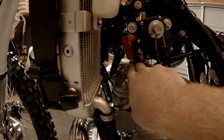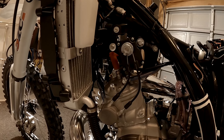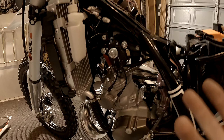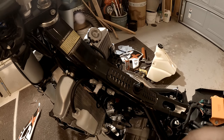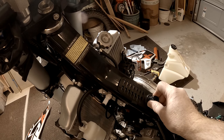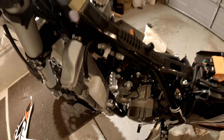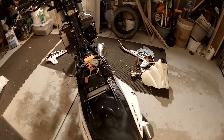We'll assume the spark plug is okay for now, which I would probably change out to a name brand after I get some rides on it. It's easy to get the tank off - literally take the shrouds off and it just sits on with one 8mm bolt onto this cushion thing. You just pull the tank right off - mainly because the bike's new - but disconnect your line from the petcock and there you have it. Let's take a look at the other side.